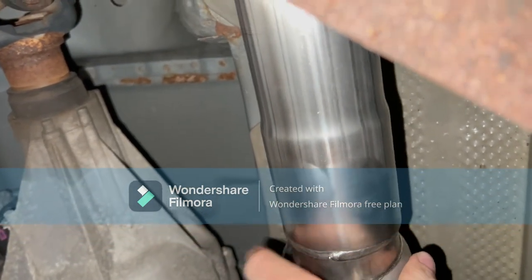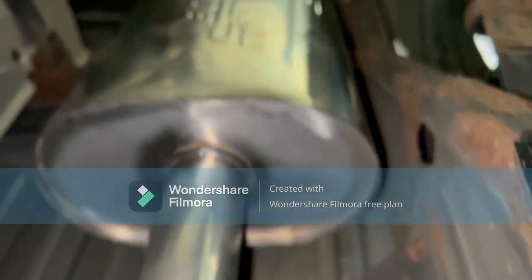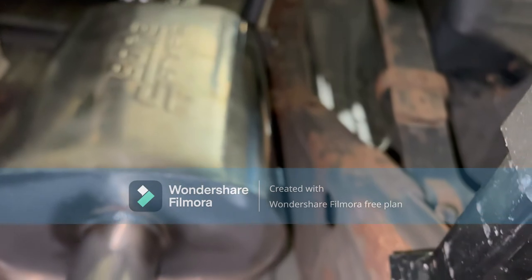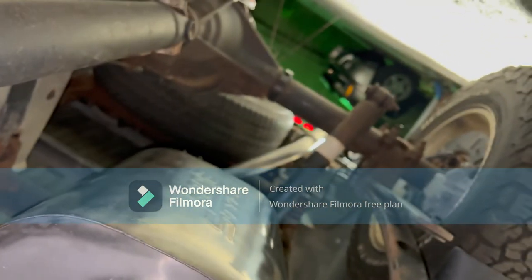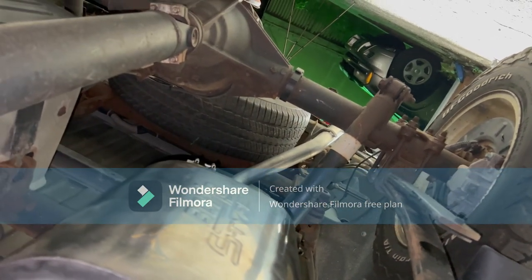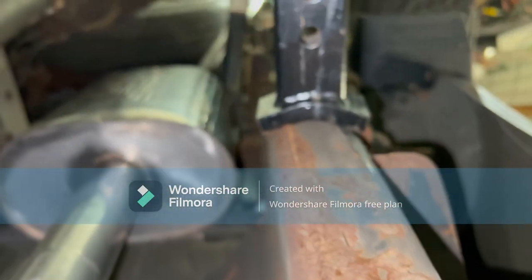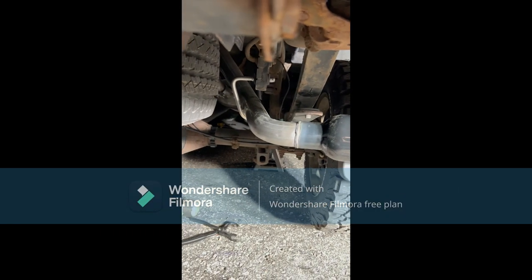As you can see, the clamp is on there but not tightened — I can still move it if I need to. I didn't crack it down or anything. Got the hangers in. You can follow that exhaust pipe, but the clamps are just dangling there for now. There's the muffler — still need to adjust it a little bit because the exhaust is sitting slightly sideways. The other exhaust pipe is going to pop out behind the wheel. Right now when you put this in, you just get the hangers on and the pipe in place so you can move and adjust everything.